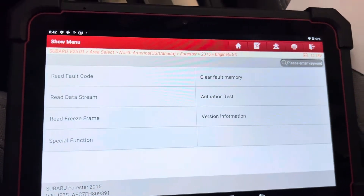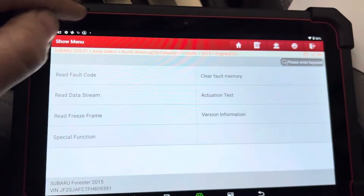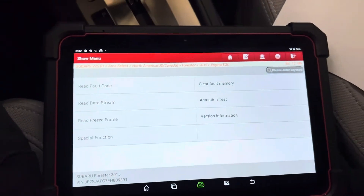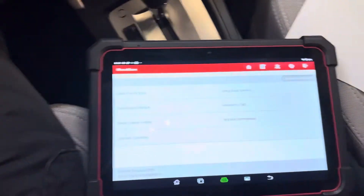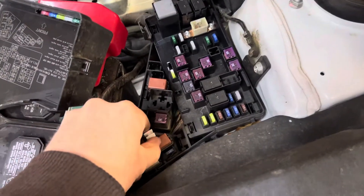We're no longer in test mode. We are in inspection mode — the cooling fan is still running. I'll shut it off and exit the inspection mode as well because we want the data pins to update. To exit that mode we just have to remove this fuse.